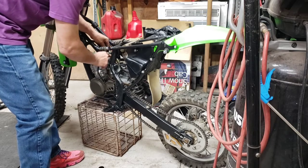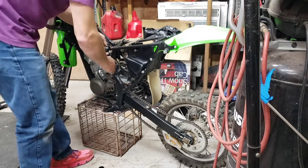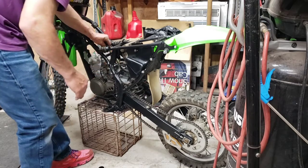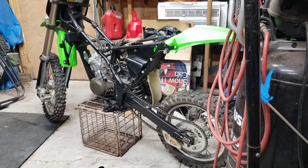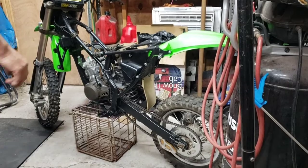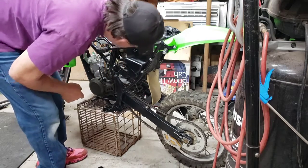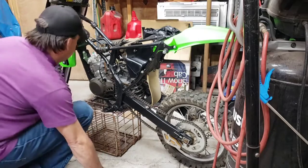Carburetor slide back in. That doesn't look right. Seems like it's in a bind. Yeah, it's gotta be right. Alright, we're gonna bring it back in. Let's see. Must put the cover on twice. Or the throttle. Alright, throttle cable reinstall. Make sure the slide works. All the way up. All the way down. We're good there. Get ties back on our wires here.